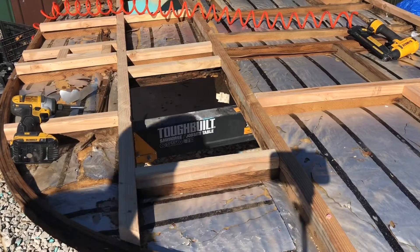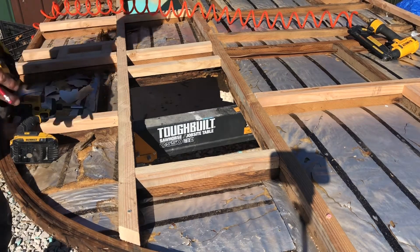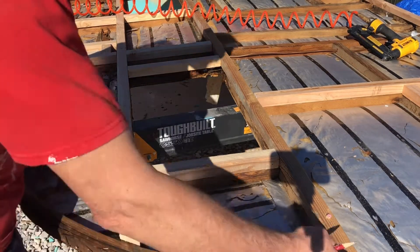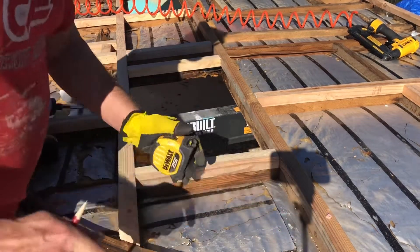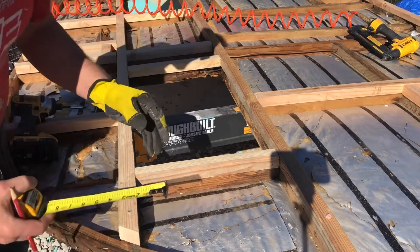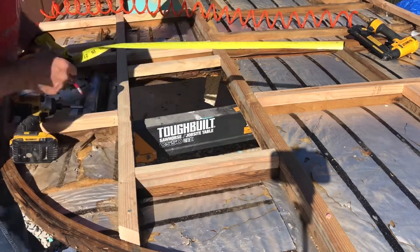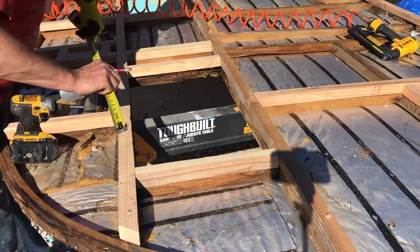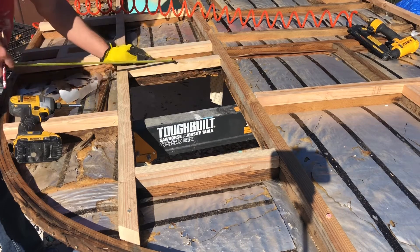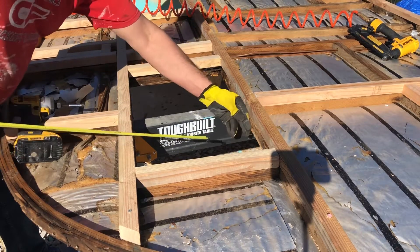A couple of things I wanted to show you before we got too deep into rebuilding. First thing I did is they ran these two long ones all the way down. I got them on right on the angle they need to be, screwed them in, and these are going to be where we base everything off of — because these are the ones that matter. These are where the windows are. So these windows have got to be 24 inches top to bottom, because they're 24 inches wide, and they're about 14. So we've got to be 24 by 14. The skin's not going to move, so we've got to make sure we've got these exact.